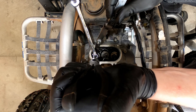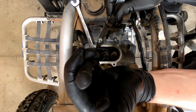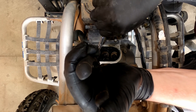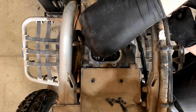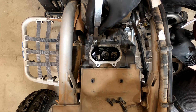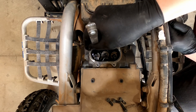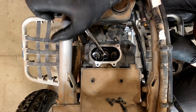Here we are adjusting a second time: loosen the adjuster back, put the gauge in, snug it up just a little bit, and then tighten the nut down. You may have to do this more than once — in this case with this valve I ended up having to make this adjustment three times. After you've made the adjustment it's basically the same across the other three valves. When you've adjusted all valves, go ahead and turn the engine over three or four times to make sure your spec is still accurate. The feeler gauge should fit snugly — some tension but not a ton — and you should be able to wiggle it without any slop. Always check, double check, and triple check your adjustment. Make sure your jam nuts are locked down tight so they don't come loose while the engine is running.